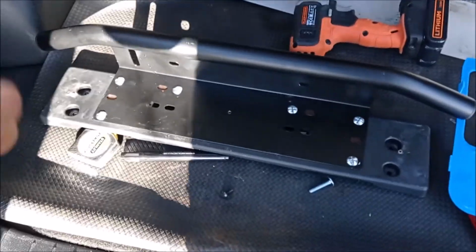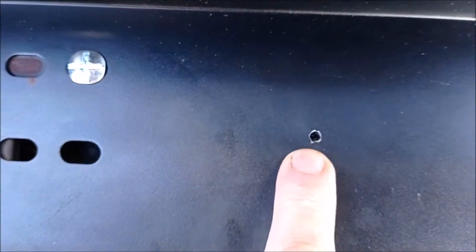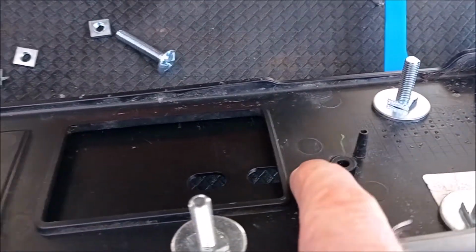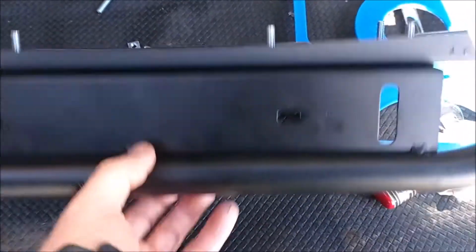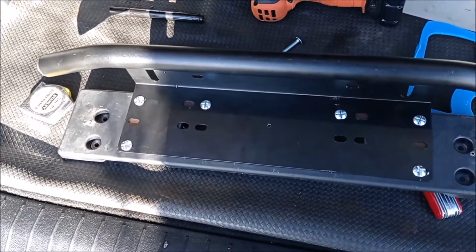So this is where we are now. We've put in these coach bolts, and we've also drilled a 4mm hole to put through the retaining screw that goes through on the back. Now obviously we're going to have to cut these nuts down, or these bolts down, if there's any chance of this fitting back against the bumper. The only thing we're not sure about is how secure will this be, because it's only held on with 5 self-tappers, but this is us just trying it today.